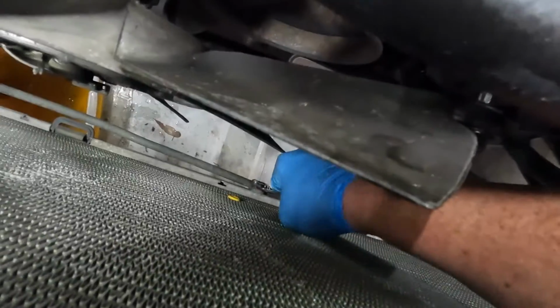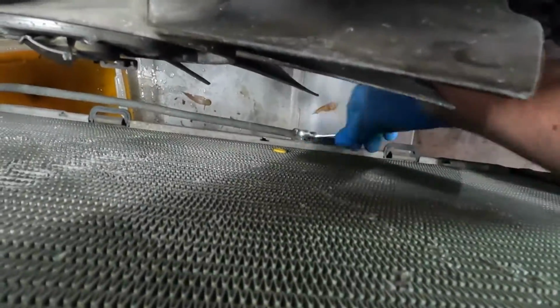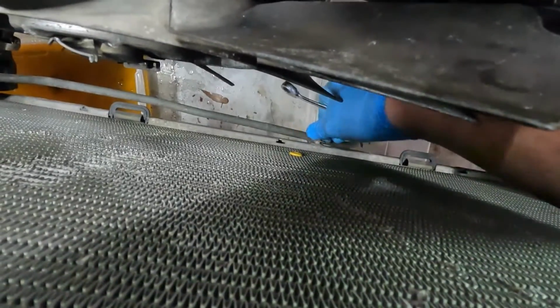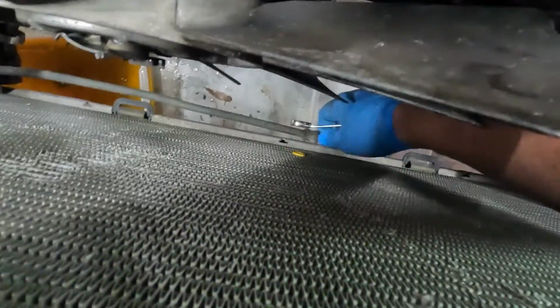And then moving to this gem right here. I believe that's 10 millimeter. Alright, cooler line is loose. Dropped my screw. But that's loose, and I'll go ahead and undo those two. Move the coolant catch basin, and then start trying to catch some of that transmission fluid and pull this radiator out.